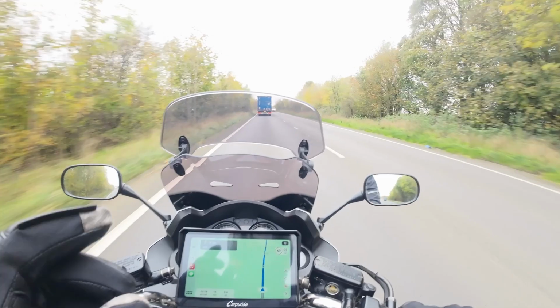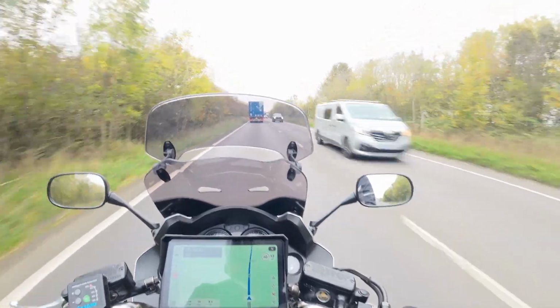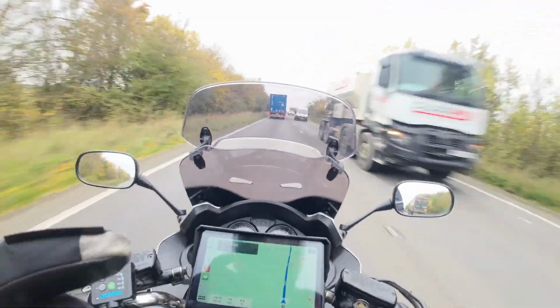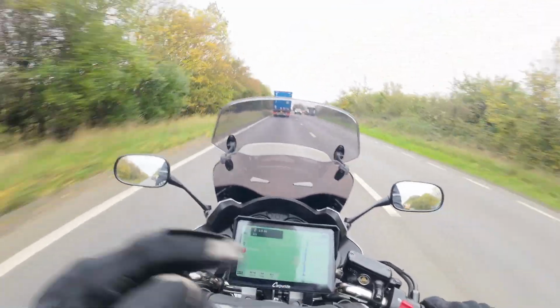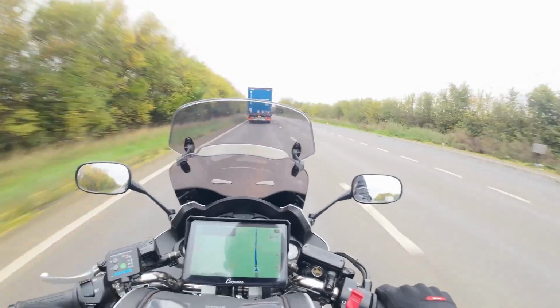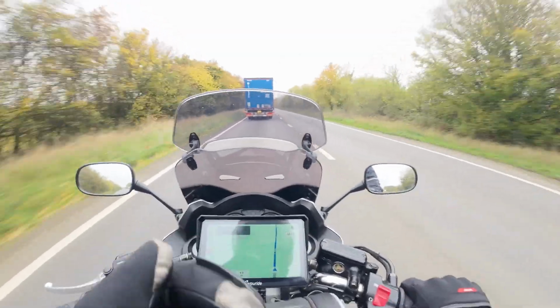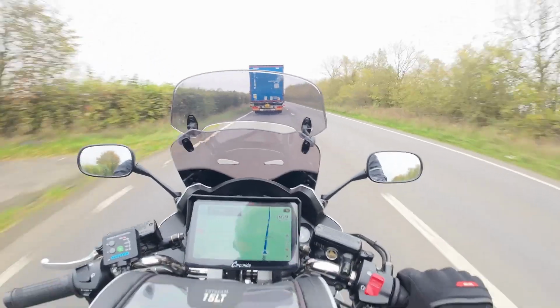Luckily, when I did lose the nut on it, it was when I first got the bike. So I've got some longer screws and they're fine. The trouble with this battery is it sits at an angle. If you loosen off the negative terminal, the retaining nut just falls out and drops down the engine. Something to be aware of if you've got one.